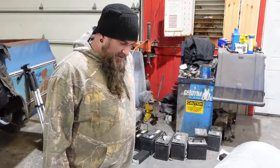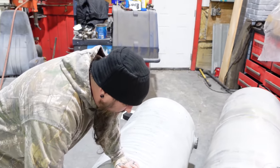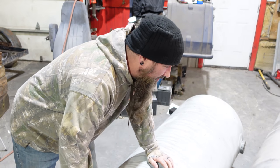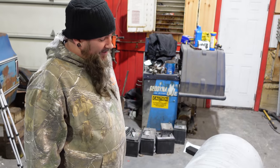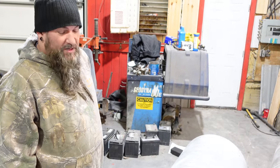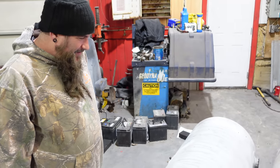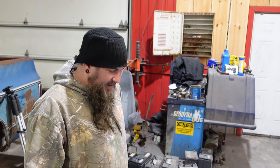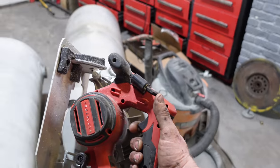Well, we're gonna try to cut these tanks apart and weld them together. I don't particularly know if they're the same aluminum, like 4043 here, maybe 4027 there, I don't know. They're quite old, so there might be a bit of contaminants in there. Oil, grease. We're gonna cut it, so it's gonna contaminate it again. And we're just gonna make it work. So you're saying even the zip discs leave contaminants in there? Yeah. Anything that touches the thing is contaminated now. Okay. Well, I got you, Vince.